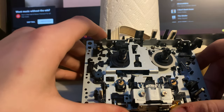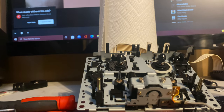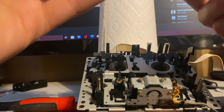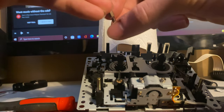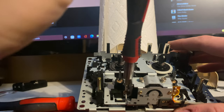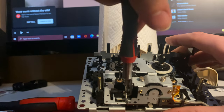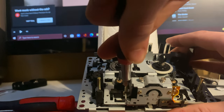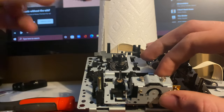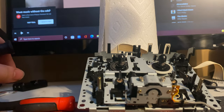And your head's on — not fully tightened yet. Set it down and take your screws. Do not make the mistake of tightening these down super tight. Those screws have probably been in there since this cassette deck was made, probably late eighties or early nineties. Just kind of tighten them — this thing isn't going to get much vibrational use to the point where they need to be super tight. Just hand tight, not finger tight — hand tight.